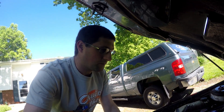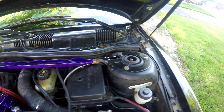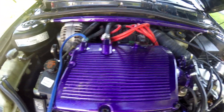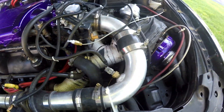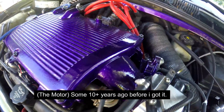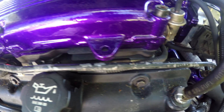Because it's a full 3.5 swap, you actually need something to help with the fact that the internal crank trigger is different on a 3.5. On my motor they actually welded on a 3.4 crank trigger onto a 3.5 crank, so I'm able to put this motor in without almost any modification as far as that goes. The upper wiring differences I still had to do. As of right now it is a stock bottom end. I did a double roller timing chain — I was able to get a TCE one brand new in box. I did a Wo-Tech turbo cam, and to go with that I did the valve train: comp springs, longer pushrods, all the hardware — all came from Wo-Tech brand new. When the engine was at Milsey they did what seems to be gasket matching with the port work.